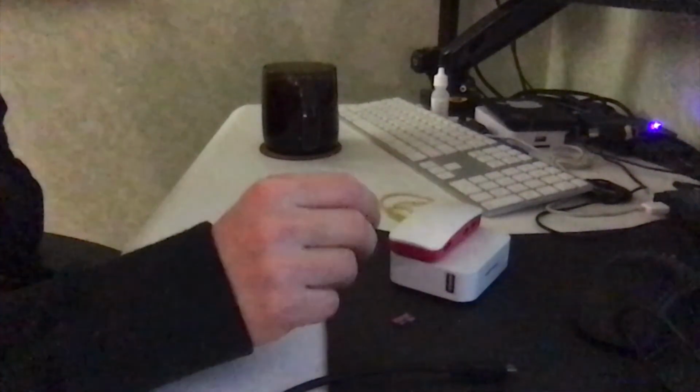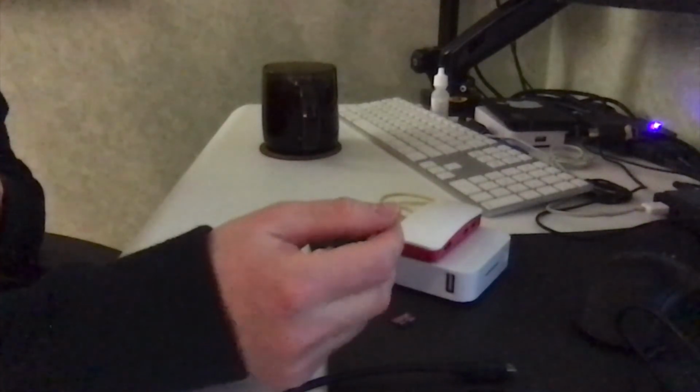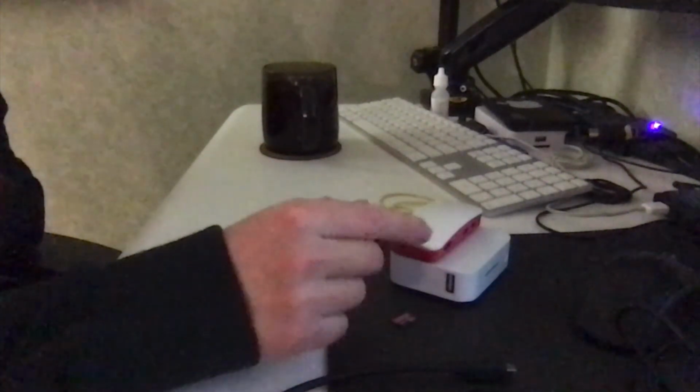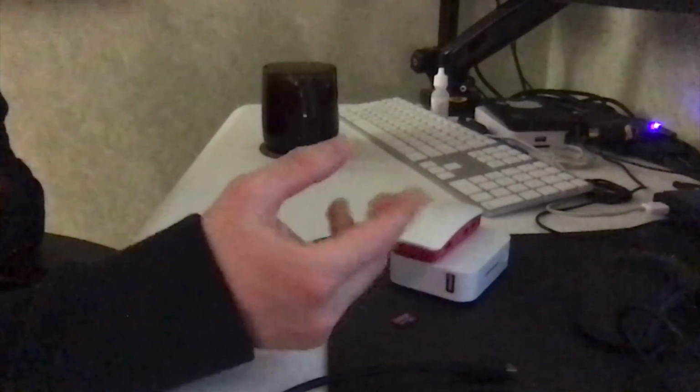A second thing that we will want to do, once we put the SD card in the Raspberry Pi, is install libgphoto2, the dependency of GPhoto2Server. We need to put GPhoto2Server itself in there, which is a very simple step. It's the simplest step among all of them, I guess. And then what we also need to do is turn it into a Wi-Fi access point, so it would have its own Wi-Fi network, which you could connect to with your smartphone.